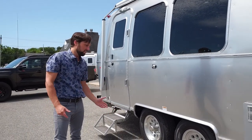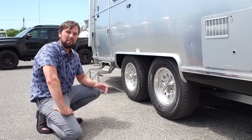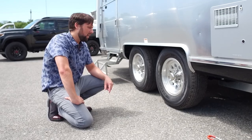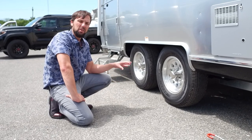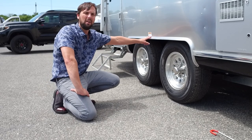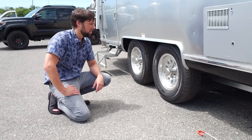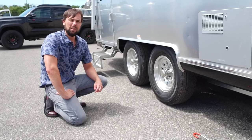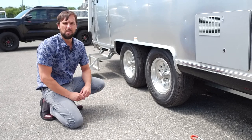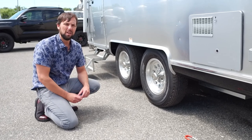These are Goodyear Endurance tires, a new upgrade over the last year. They're to be inflated to 80 PSI with a high speed and load rating — load range E, ST-225/75R15s. Check your tire pressure before every single tow, and also check lug nut torque. If you remove a tire, do the lug nut torque at 10, 25, and 50 miles on your first trip to make sure it's properly seated. These have Neverlube hubs so there's no bearing maintenance — people have well over 100,000 miles on Neverlube hubs and they're still going.